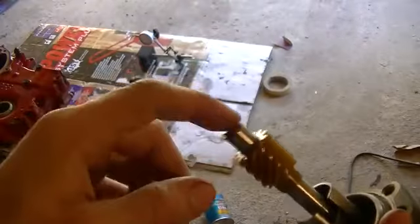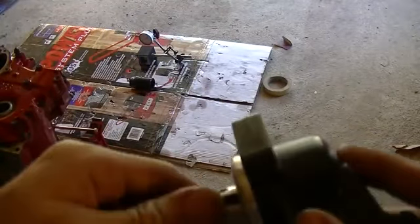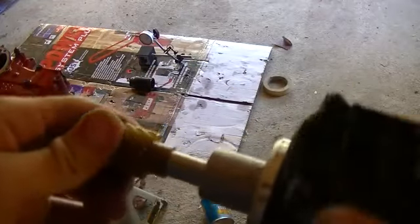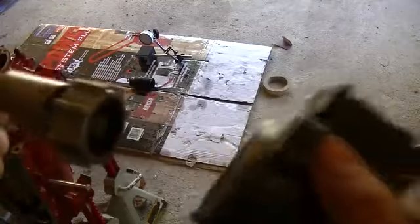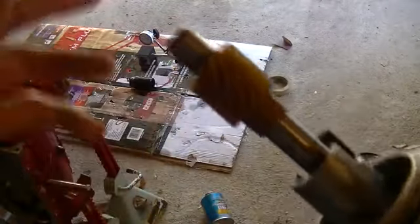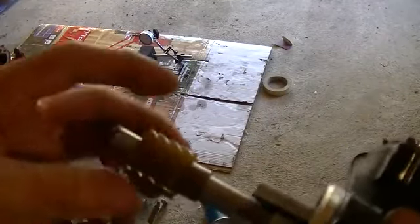Older transmissions have governor assemblies. Newer transmissions do not have a governor assembly. The governor pressure is controlled by a solenoid. The computer will read the speed sensor, which is pretty much exactly this, but without this whole gear thing. And according to the speed, it will adjust the pintle width in and out of the solenoid and adjust the pressure from the governor.